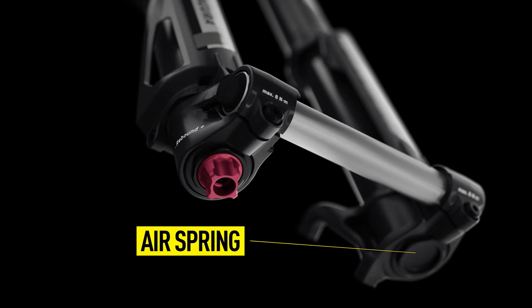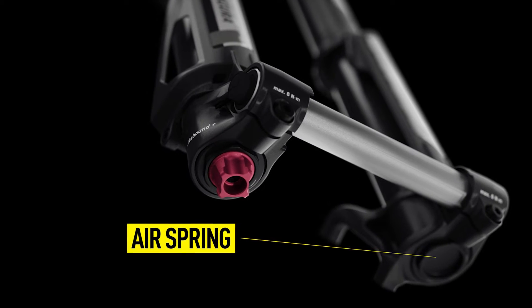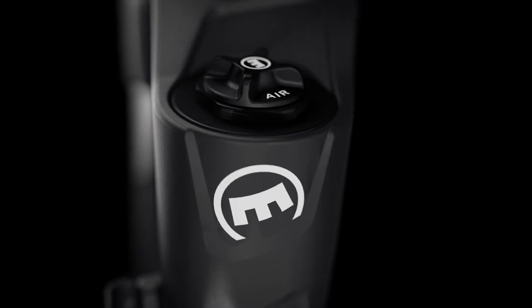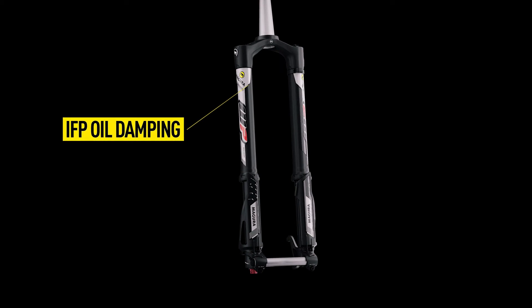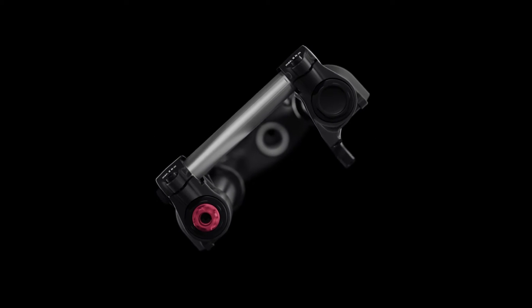The fork settings can be simply modified to suit the rider weight through adjustment of the air spring rate and the adjustable rebound damping. The air spring setting is found in the left fork tube, and the oil dampening in the right fork tube. On the bottom of the fork tube is a rebound dampening adjustment, which controls the rebound speed of the fork.